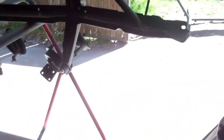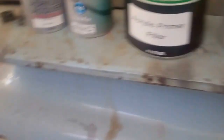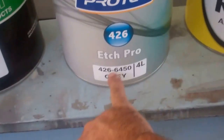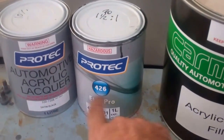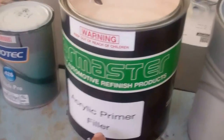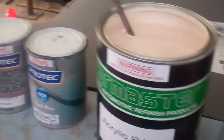Here are a few bits and pieces that are now going to end up in primer - all front end stuff. I'll let the primer sit for about a week, let that shrink back, and then put these front pieces in semi-gloss black. These are basically the paints I'm using for this car. The car is going to end up being painted in acrylic lacquer because I'm spraying this myself - I'm not doing this in 2K paint. This is my etch primer - I've got grey and I've got a litre of black right there. All the front end parts, obviously the black parts, are getting etch primed in that, and the other stuff like the body in the grey. And I've got my acrylic primer here which I'll use to thin it all out.